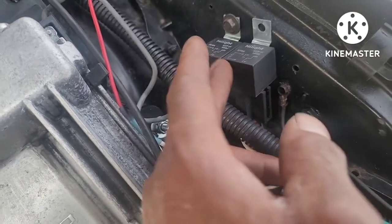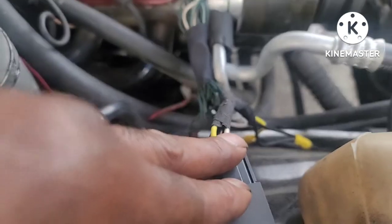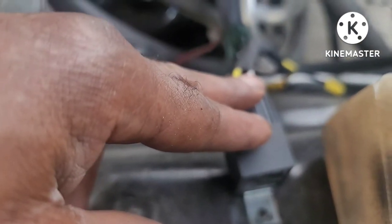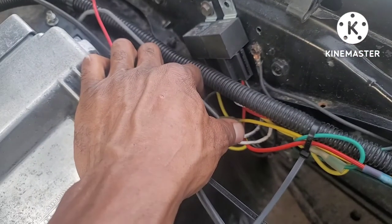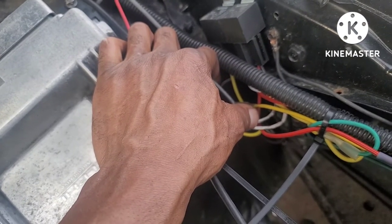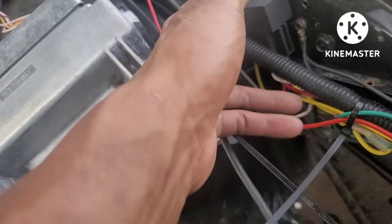I got a low and a high relay. Also, to make the fans come on with the air conditioner, what I did was I made a negative output relay. So basically it's a negative output going over here, and I spliced it into the low side fan negative trigger from the computer. So basically when you cut the air conditioner on, it's getting a negative trigger like it's getting a low speed fan trigger from the computer. That's basically what I did to make it come on.